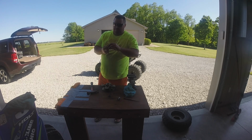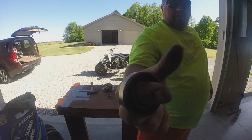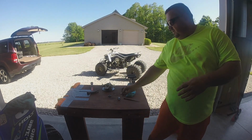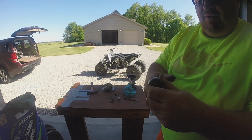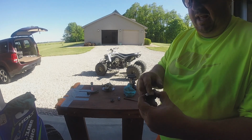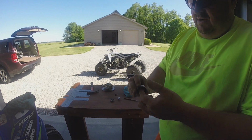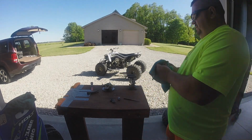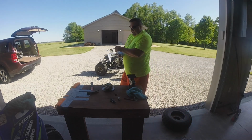And oh yeah, this bearing is definitely, it feels dry. It feels really rough. It's not smooth. And honestly, this bearing here is not much better. It feels like something's rubbing the whole time. Of course, I just beat the hell out of the inside race. But I noticed that when it was in the bike, or when it was still in the spindle. But yeah, it's rough too. So they definitely needed it replaced. It was a good call to do it. So let's go ahead.